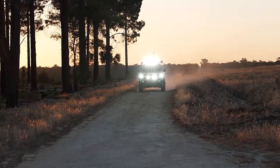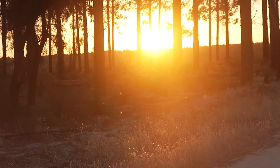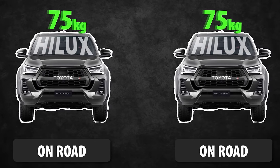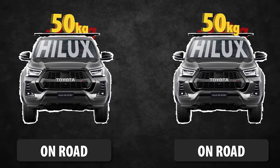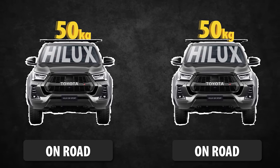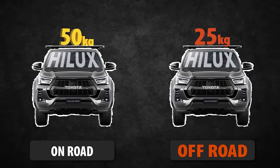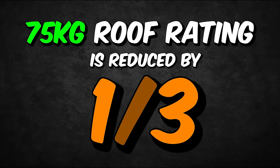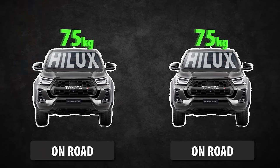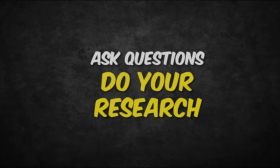Here is the most complex thing when it comes to roof racks: some brands reduce the load capacity of your roof if you are off-roading. There is a difference between on-road and off-road, not for every brand however. Let's look at this Hilux. Two identical Hiluxes, both with a 75 kilogram roof rating. Let's add a 25 kilo roof rack to both — both have 50 kilograms of capacity remaining. Everything is as expected until the Hilux on the right hits the dirt road. It's off-road now, and it's reduced to a 25 kilogram load because the 75 kilo roof rating is reduced by one third. So the two same Hiluxes with two different roof racks both head off-road — one is reduced, one is not. It all comes down to the brand. Do your research. More importantly, how is it mounted to your vehicle? Is it pop-riveted to the roof? Roof racks coming off on roads, during accidents, during heavy braking, off-road — nuts and bolted, using the existing tracks on your vehicle perhaps. The hardware that's designed to have a roof rack is the best to use.